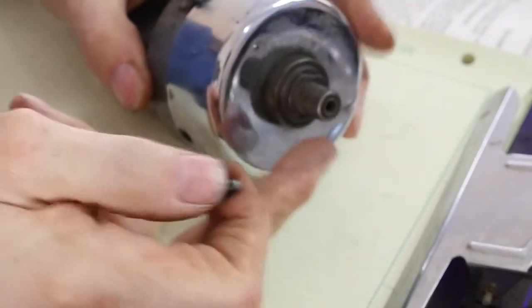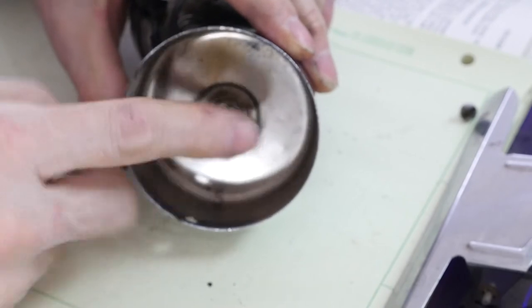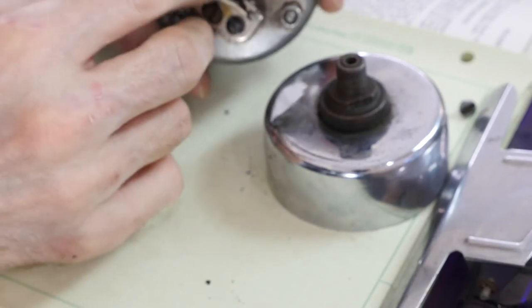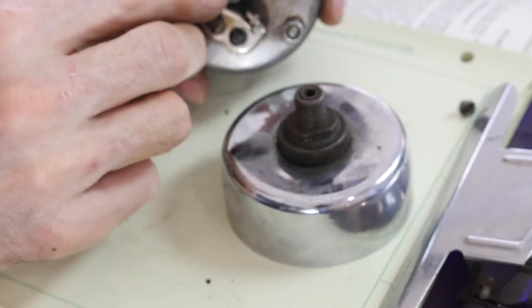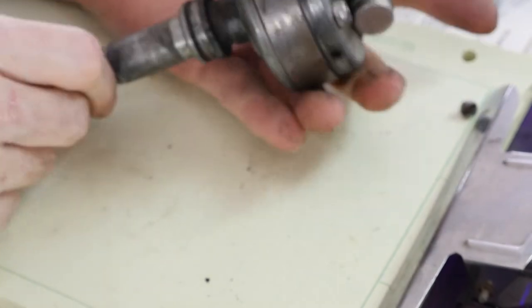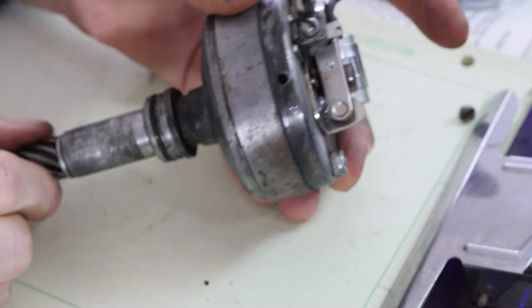Let me get this little side screw off. It's got a tach drive on the top — a mechanical tachometer drive. This one I happen to know is broken because on the inside it's just got this little nub here, and it's supposed to have a nice big nub that goes down. This should be a square drive — this might not be the right part. That little nub fits into the end of this shaft. So, auto advance — it's got the O-ring down here, it's just different.